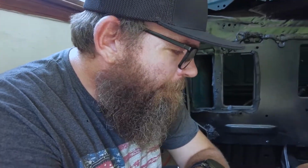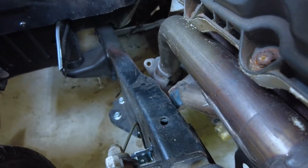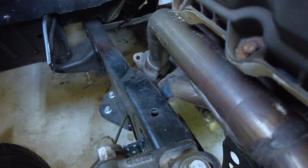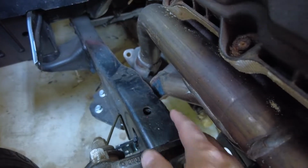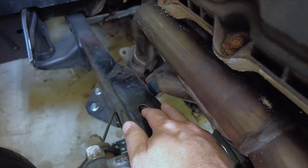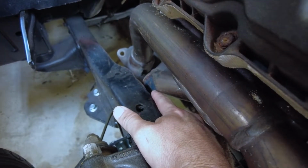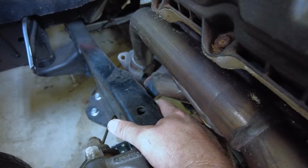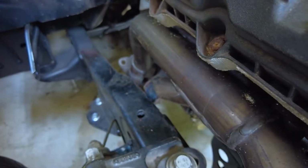I don't think we showed in the video a little bit of the grinding and stuff. We did recess the frame a little bit off camera. Yeah, that's what Ryan was referring to, trying to get some clearance there. It was actually right here behind the 321 piece that we put in. And so we did recess that, and we welded a new plate in there. And then with Clint's awesome weld job right here that he did with that really cool battery TIG welder, that was pretty awesome, and what you guys saw in the video. Now I believe we have adequate clearance, right?